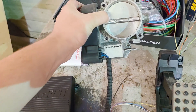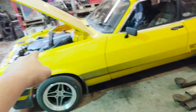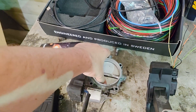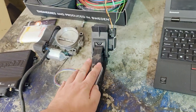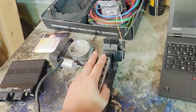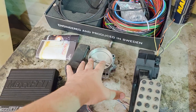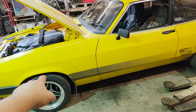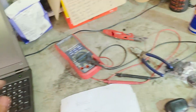I've got this random AMG throttle body here which can actually go on that engine — the second engine. I don't know why it's got an AMG one but it makes no difference, it's the same size. We're going to try to wire that up to the Max ECU, and out of the Crossfire I've stolen the electronic pedal. I'm hoping this will fit — if not there may be a Golf one I can use. If we get that working successfully there should be nothing stopping me wiring it into the car.